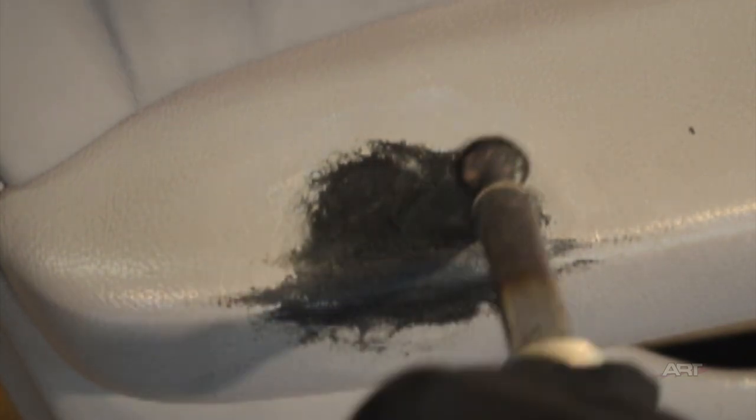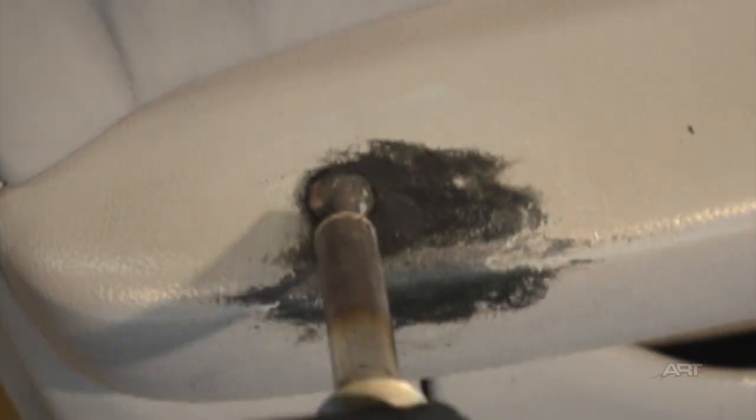Once the main part of your repair is filled in, cool down your tip and lower the rheostat so that your iron is now a bit cooler. That way you avoid digging in too deeply and you can just smooth only the surface. You may find sometimes that 100 grit sandpaper helps to reveal the high spots.